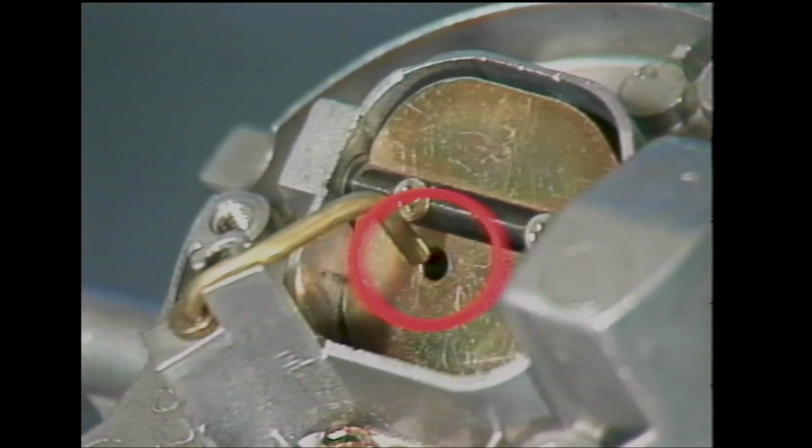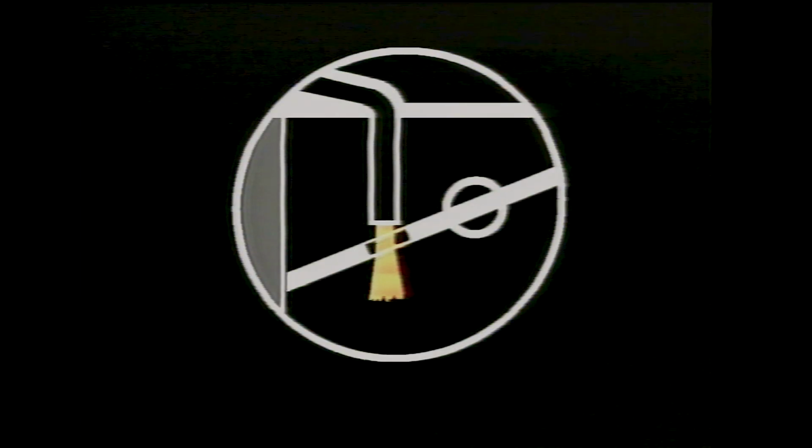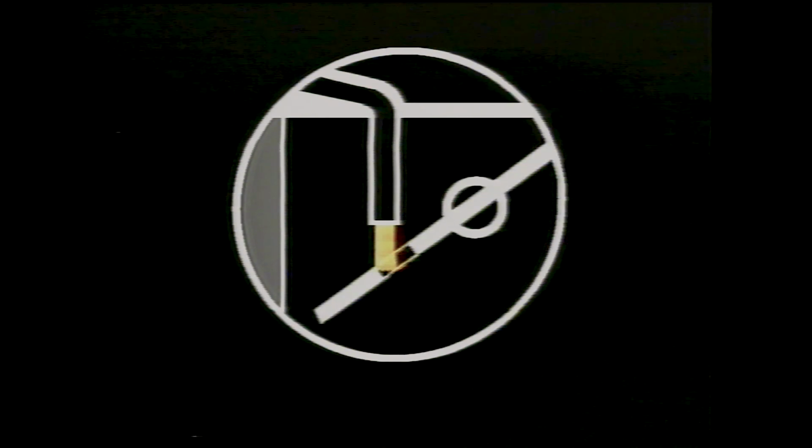This only operates when the engine is cold enough for the tension of the choke bimetallic spring to fully close the choke valve. In this position, this hole in the choke valve is close enough to the end of the full load enrichment tube to create a depression at the end of the tube. This causes extra neat fuel to be drawn into the engine for cold starting enrichment. As soon as the engine fires and the choke pull-down diaphragm pulls the choke valve open, the enrichment stops.